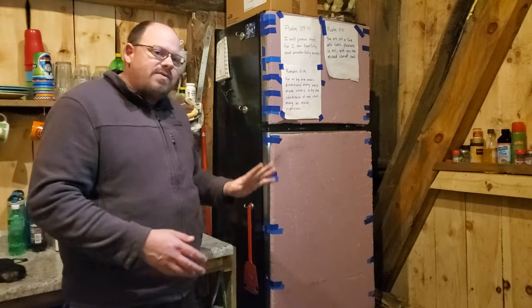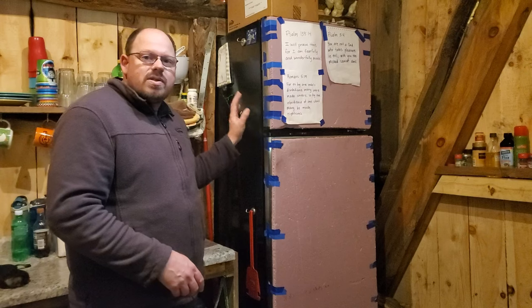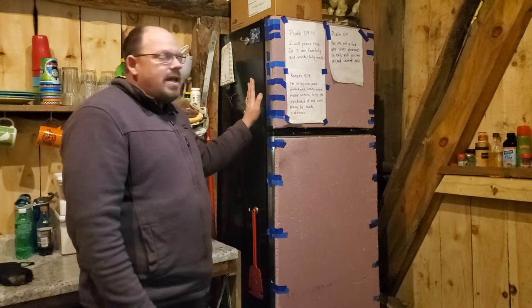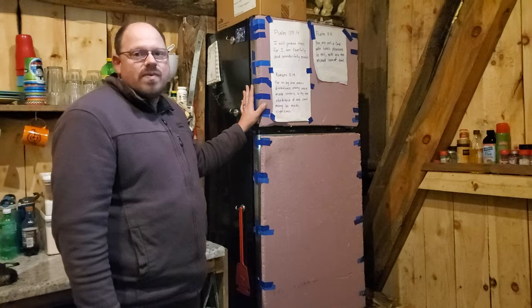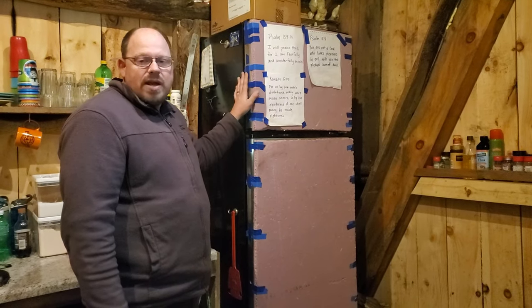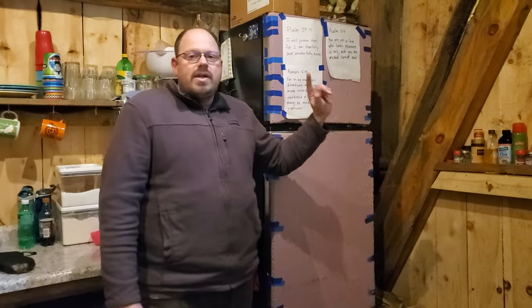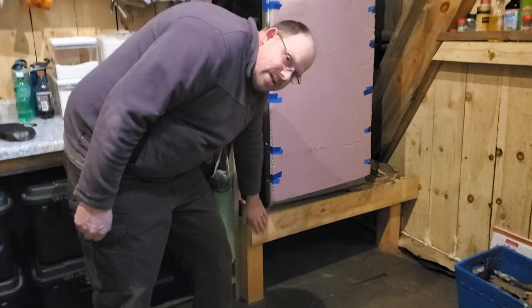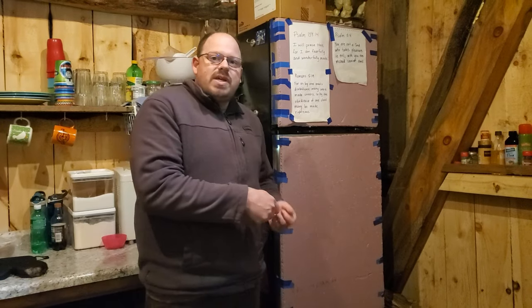The other problem is that this fridge, like most modern fridges, has an automatic defrost. Anytime the moisture level inside gets too high, the fridge heats itself up on the inside and runs a bunch of air through to get that moisture out — and that takes a lot of energy when you're on solar. We've actually run our batteries dead a couple of times already when this thing was simply trying to do an automatic defrost, and we have no control over that. So we're going to get that chest freezer we bought, take this fridge out, remove the stand, and set the chest freezer in place. But first we need to take out the thermostat and put in a new thermostat regulator made for a refrigerator.